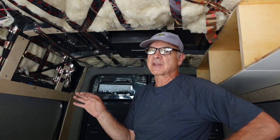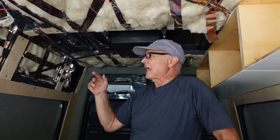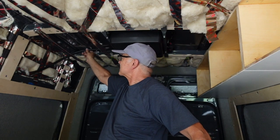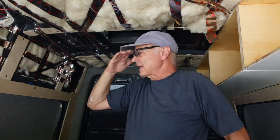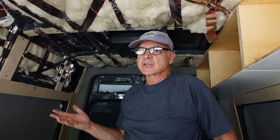It's about $2,700 plus shipping, so everything will put you right at about $3,000. Is it worth it? If you live in a hot climate or travel to places that are hot, I think it's a no-brainer. The install is really pretty easy — no more difficult than installing a fan in your roof. You just cut the hole, install it, and it comes with all the wiring — a big six-gauge wire cable. I ran it to a separate 60-amp breaker.